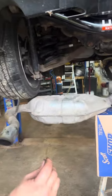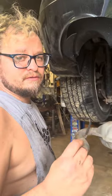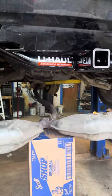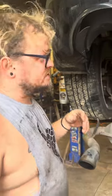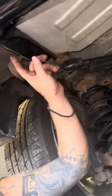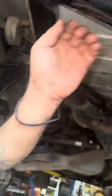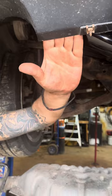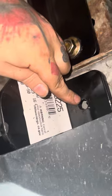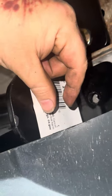Hey guys, you know what this tool is? That's a bolt fisher through frames, for installing trailer hitches and any other reason you may need to. We got our holes drilled out here — here's one, two — and I left them loose so that I can get my hand behind here better. Here's the third hole. This is our last hole that we got to go right here. I already got it drilled out. It is sagging about that much, but this is how you use this tool.